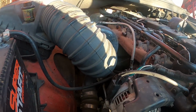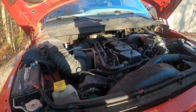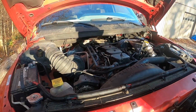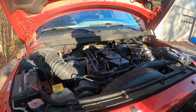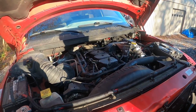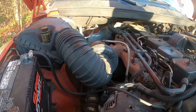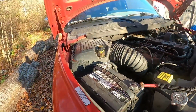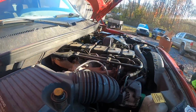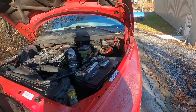So I think that at some point, we'll definitely swap this turbo out. He doesn't need to swap manifolds, just the turbo. We could run an HX350 or HE351 or HE341. I have an HE341 for you if you want to throw it on, once I swap my HE351 VE on. Other than that, it definitely needs an exhaust. That is dinky. You have like a 3-inch exhaust. If you're gonna start adding power, which we're definitely gonna start adding power, because you said it's a dog.